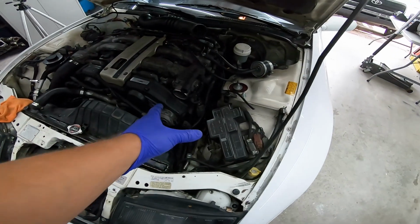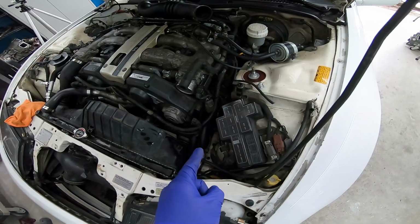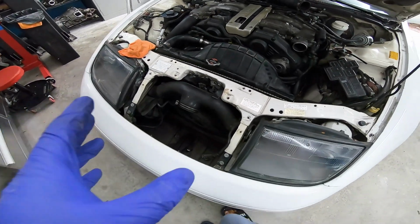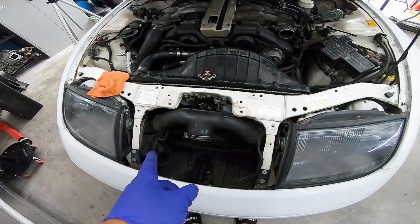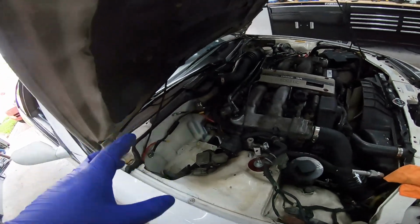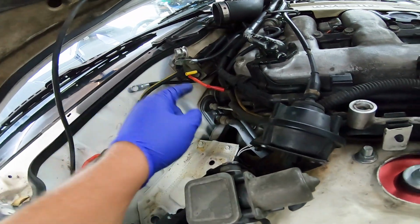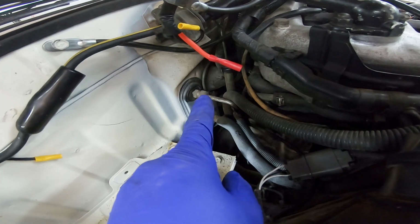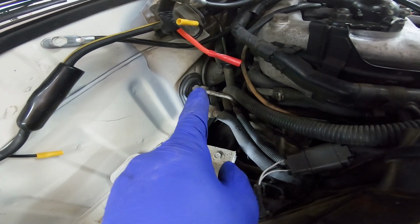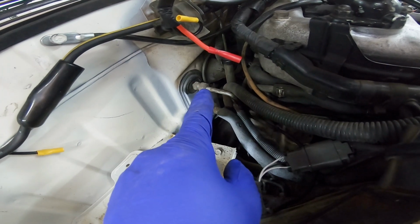All right guys, so we got our intake tube off of the driver's side out of the way so we can access our compressor. I went ahead and pulled the nose panel and the air box so we can access our receiver dryer. Then over here, pulled our battery out, removed our cowl first so we didn't break it, removed our battery. This is gonna leave us access to the evaporator. Those are the lines going into the evaporator. We need to disconnect them on this side, and then we'll go work on the evaporator inside.